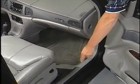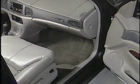the car. However, a leak at the front ditch seal could run around the door lace molding, across the door sill, and back into the rear where it accumulates by the back seat. So if you have water in the rear and no other leaks can be found, check this area.